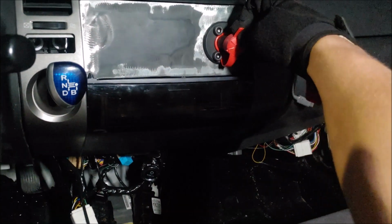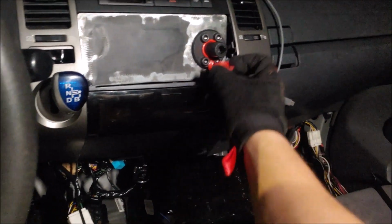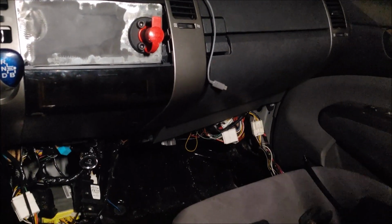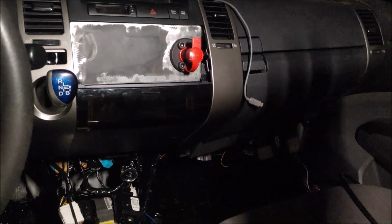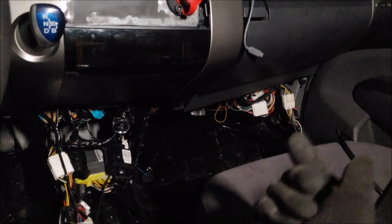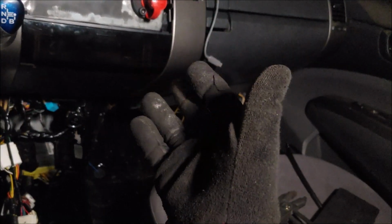But yeah, this little thing, you can just remove it, insert your little key, and then you can start the car, which is really nice. Especially when I dehybrid this car, it will be really crucial, because if anything happens, I can just kill the entire car. I can reach it easily, and it'll be good to go. But overall, this is pretty much the first step of converting this car to a manual car. Obviously, a bigger battery and more cranking amps are needed to actually be able to start the car. The next video will probably tackle the starter wiring and the alternator wiring, hook those up, see if it's easy or not, and then move on from there.